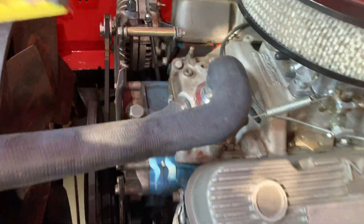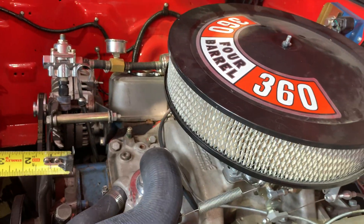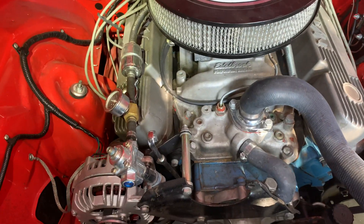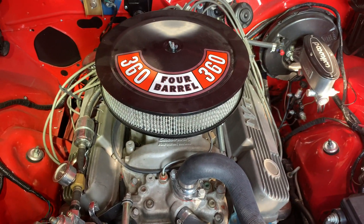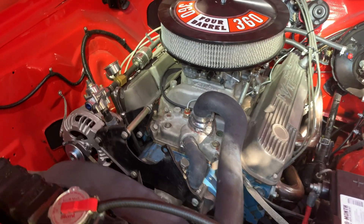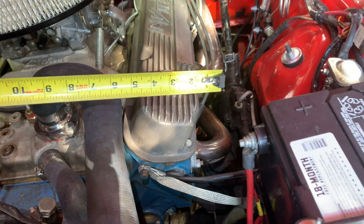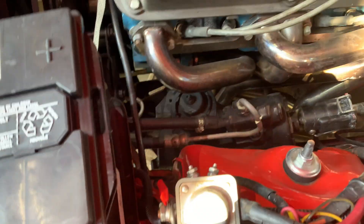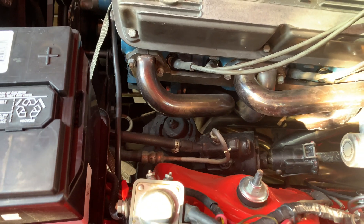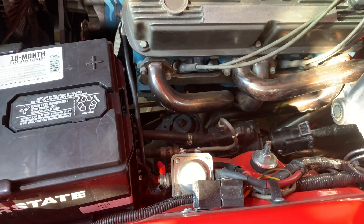On the front, 10 inches from the radiator. We have options with radiators and electric fans if we need to. Now the width - this engine bay was designed to fit the big blocks and even the 426 Hemi. So width-wise we actually have quite a bit of room. We're only looking at four total inches wider, so that's two on each side. I'm not too sure about the headers though - I know that's going to be the biggest problem. I do have the power steering box which I want to keep, so we'll just see when the time comes how the headers fit.